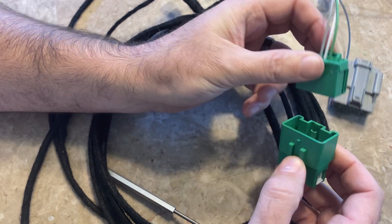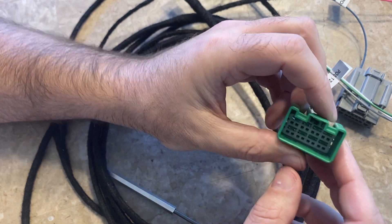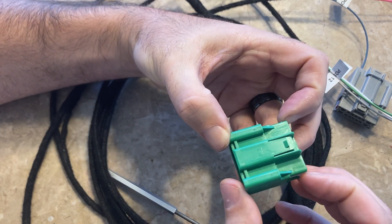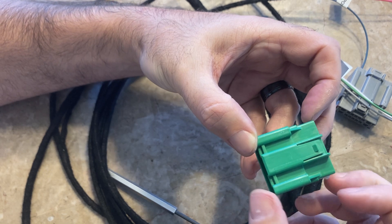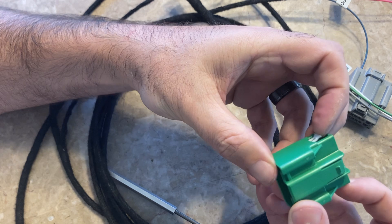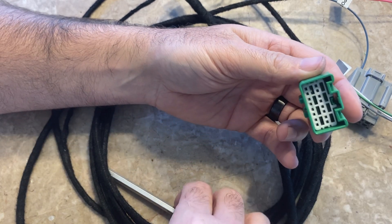If you don't have that wiring, I include an additional harness for that. This connector is push-pinned — you may want a little pry tool. It has a locking tab down inside, and there are little white tabs on the sides. Get underneath those tabs and pry them away, then push forward on them and the whole piece should slide. You can see it's coming up, and when you push that tab the whole thing is pretty free — it's unlocked and you can pin to it.